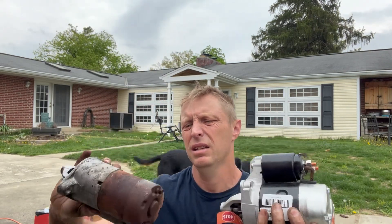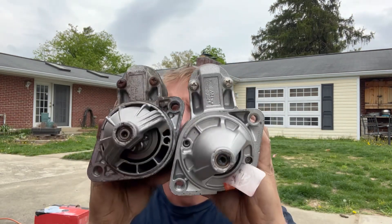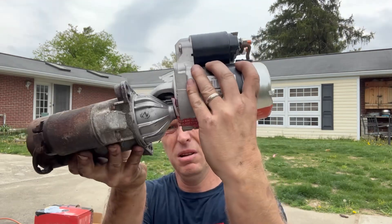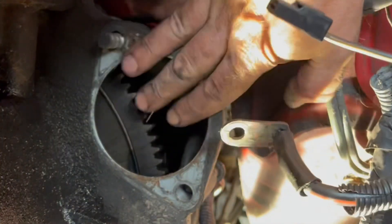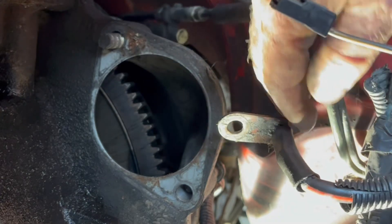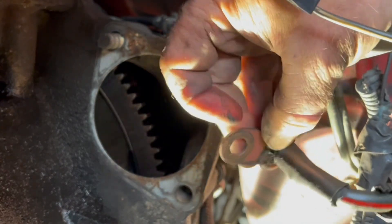They look completely different, so that's not a good sign — and this one has a remanufactured sticker on it already. Terminals look the same, so that's good. And if you look at the mounting points and orientation, they appear to be the same. Nosecone depth is the same, so we're going to say it is correct. On any starter you get, be it remanufactured or brand new, make sure that the nuts holding the two copper studs are tight, because I've gotten some that are not tight. These are tight. Here are the flywheel teeth — they all look to be in pretty good shape, practically new. This is our big terminal, and it's already in really clean shape.